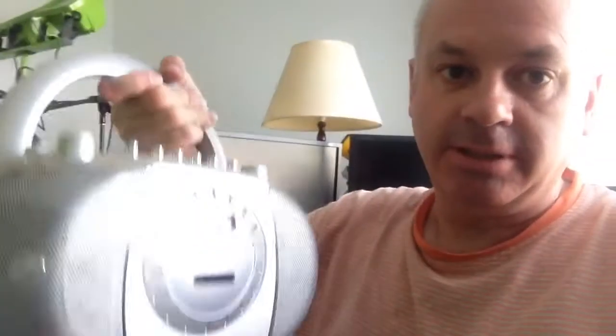But there is something on the tape. The problem is these drive belts — when they get old, they get loose and they don't work anymore. So I think I'll abandon this. I've found another cassette player — this one. This was my mother's, I think. It's got a CD on top and a player on the front. But guess what? It doesn't work either. The wheels that drive the tape don't turn. It's probably the same problem — the rubber drive belts are probably too old. This would probably be 10 years old, this one.